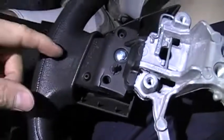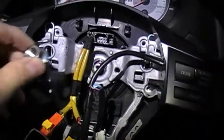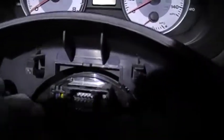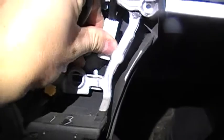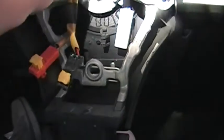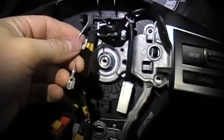Now I'll take the screw out and put my cruise switch in. I've got my switch installed and everything sorted back together. I unhooked my little stub harness that went to nowhere right here, and now I'm going to plug this one in. This one's got a little brown tab — I'm thinking it goes in here just as a holder. And then this one connects up here with the little tab that goes on the airbag assembly. That'll be next.